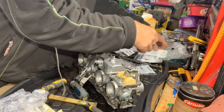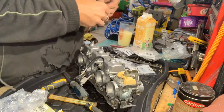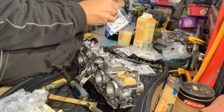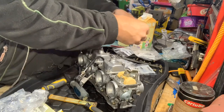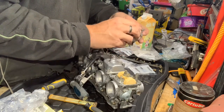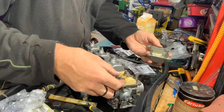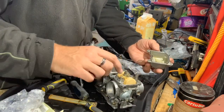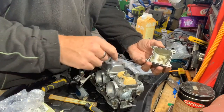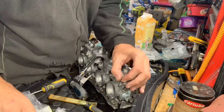I'm blowing through with an airline and then I'll get the new orange O-ring gasket on. It's like an O-ring but a funny shape — more oval, going around in a circle. The new one's been squashed a bit but it's going in fine. There are two locating lugs so you can never get it in the wrong place. The float bits were dirty as well, everything was dirty, but I've cleaned it all up.